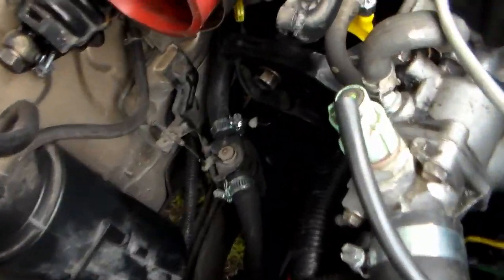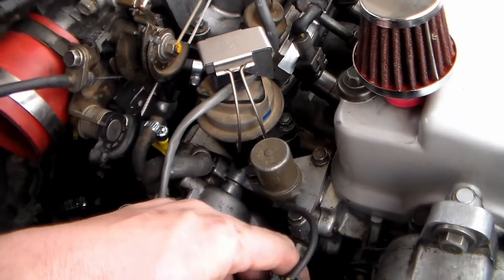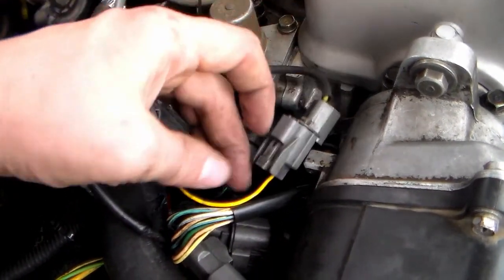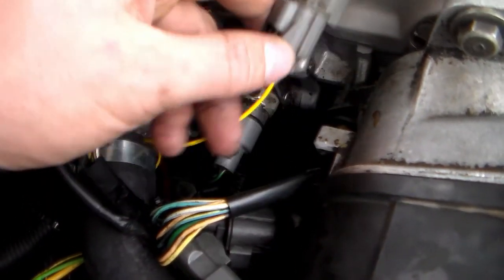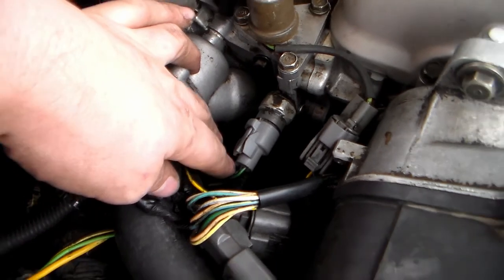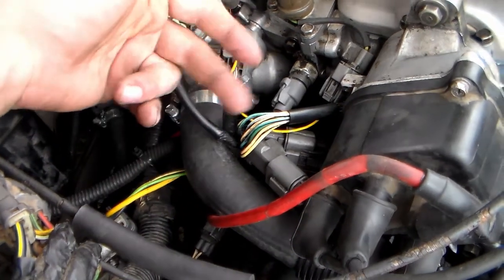I've got this wrapped up all nice and pretty. Wires come out of where the plug was, they come down in conduit, tied over here, and they come under here. That's my connector to the solenoid. I've got a new connector that I pinned with some spare harness laying around, got this hooked up, and a good connector with good wiring coming from the actual oil pressure switch. The black one over here is a ground — I've got it grounded on the thermostat housing with a ring terminal. VTEC is pinned to the computer harness and wired into the car.